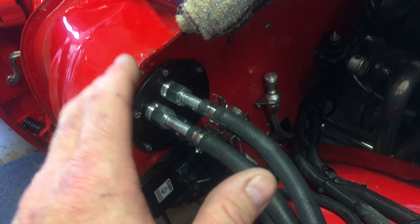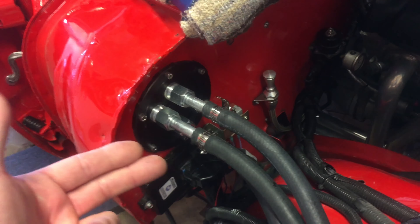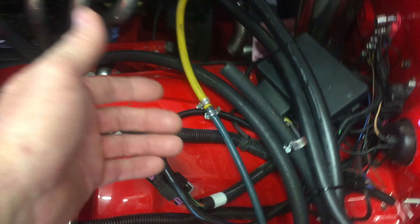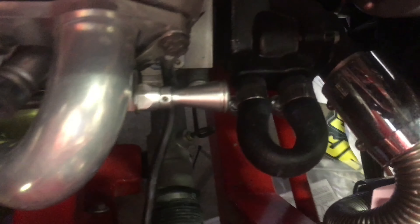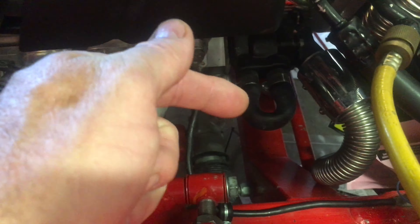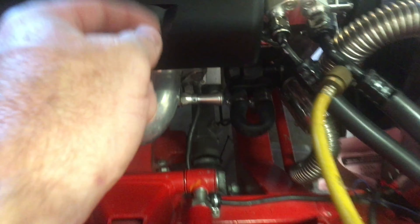It is pricey. There was that hole where the fan motor went in — I needed to close that off. I wish I could have just welded that off and got a $30 bulkhead, but this right here was like $300. So these are all my hoses — these are going to be run inside the fender well. My heater hose is here and will be tucked up in there. I will not be hooking those up in the summertime because I don't need it. But per GM, if you do not hook up your heater you cannot just cap those off — they said it will screw the motor up. You need this little loop-around hose for your water pump.